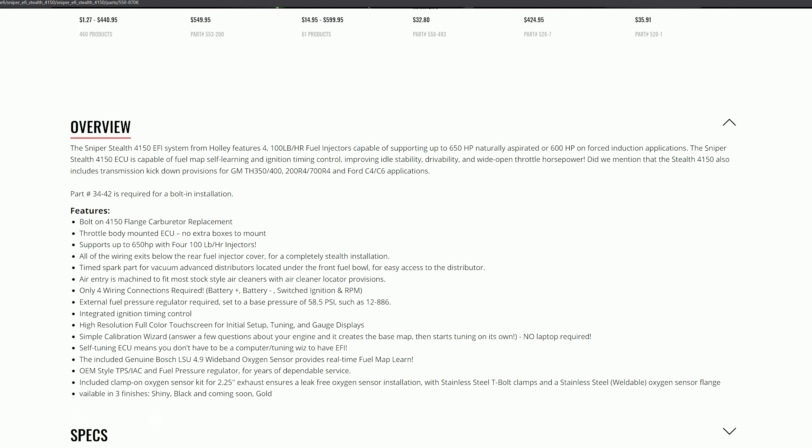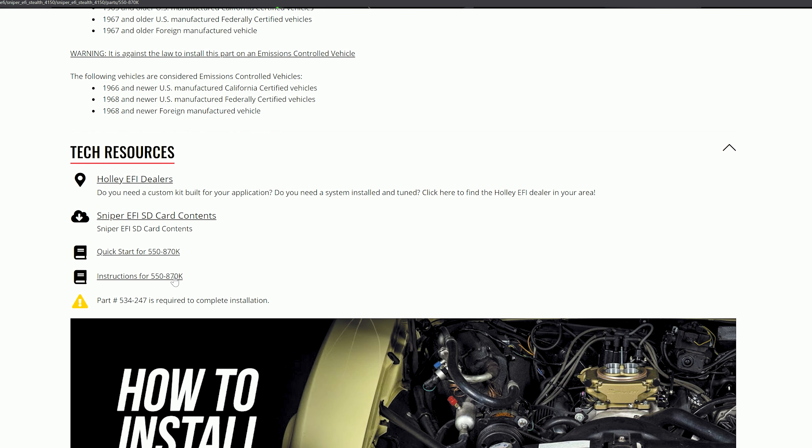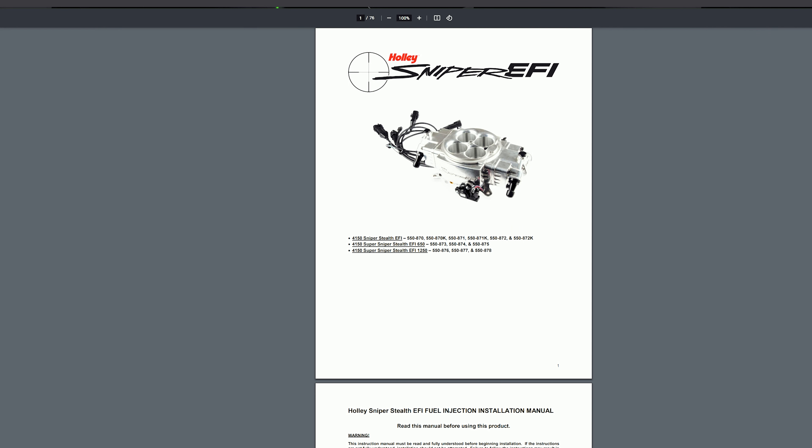The biggest thing I recommend is to go to Holley's website and download their 48-page instruction manual — they cover all the bases on different types of ignitions versus the four-page packet they ship with it. The extra cables that come with it you can de-pin and remove, or use them to trigger nitrous or plug in an electric fan, which the EFI can trigger on and off based on the temp sensor already in the intake manifold. There's a ton of versatility with the kit.